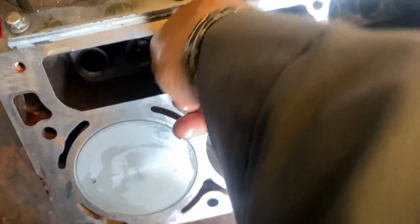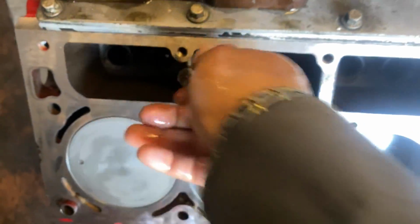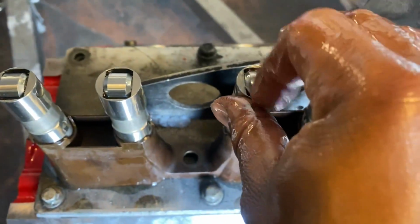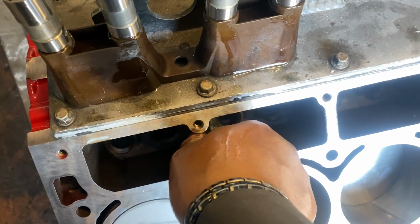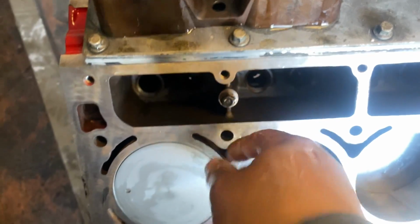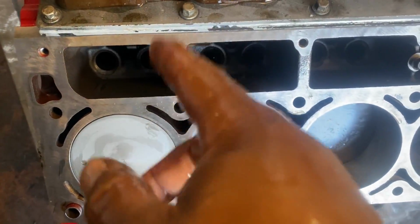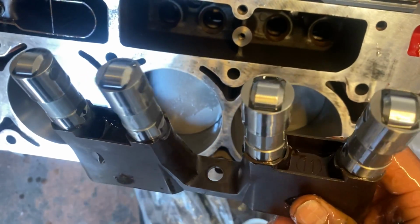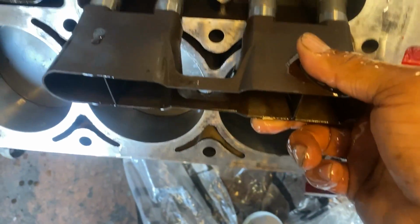It's all good. So, yeah, I got these lifters just drenched. That's why you want them. You want these things to soak. They say 72 hours, but hey, a week will not hurt it. Let's put that on with the impact. Let me get the 10 real quick. Take that off and drop these things in there. These things have been soaking for like damn near 2 weeks. You know what I'm saying?